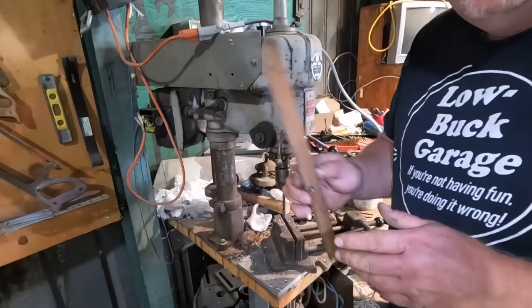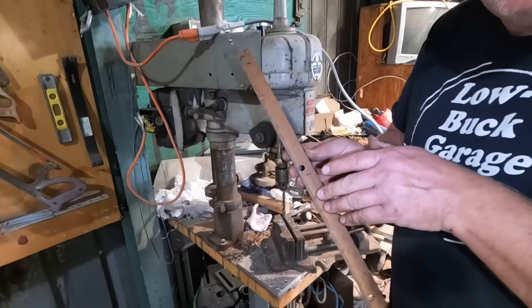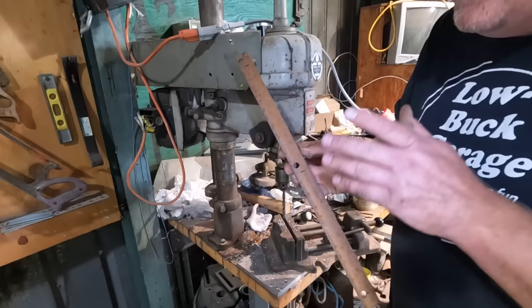I'm going to use some angle material to make my radiator adapter. And I already laid this one out and marked it. The second time I made my marks, I actually put them in the right spot. That takes a while to lay everything out and center punch it and drill it and get everything in the right location. But I've done it once, and I've got to make 4 pieces just like this that are totally symmetric. So I don't want to do this again.